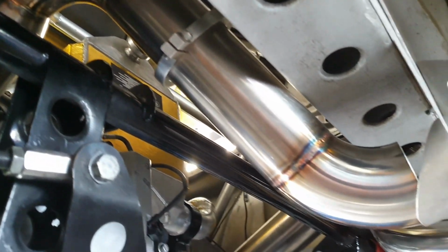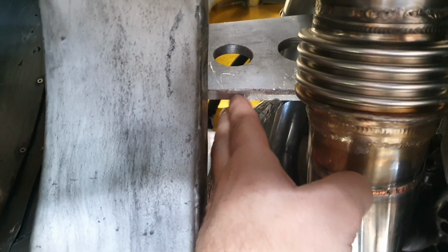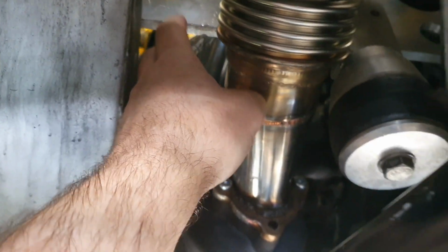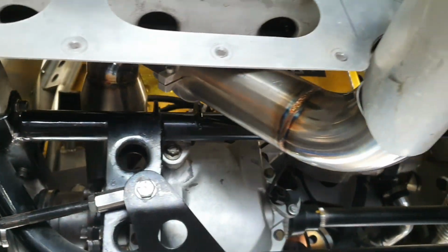This side's worse. I didn't think that would actually go in the car. I thought that would take disassembly of the vehicle to get this thing in and out, because it only just fitted with 2.5, and it involved quite a bit of pushing and pulling on various different things, and I don't know if you can see, there's a bit of scratching going on up here and a bit of clearancing happened in the past, but it does still fit. I probably will get up here with the die grinder and piss off all the neighbours and whip 5 mils off the bottom of here, and that'll enable it to come in and out without risk of personal injury.